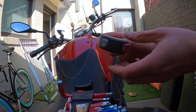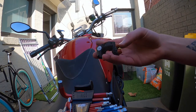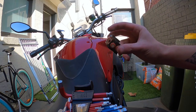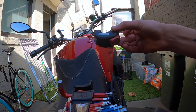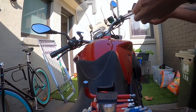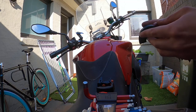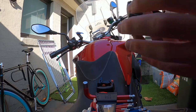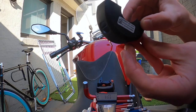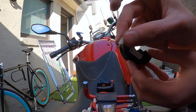This is the switch unit and it just kind of comes out once you've unscrewed everything. Be quite delicate with this — this is not the thing that is broken, it's the other side, although this looks interesting. This is the broken thing. This is the whole unit — it doesn't click. And then if you take it out, I'm going to take this button out because otherwise it will fall out. And then we've got here the clicky — now it moves — and this white pin in there is on a spring, and it's meant to be quite tactile. It's got a bit of lube in it, so that's interesting.